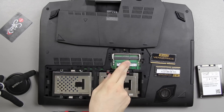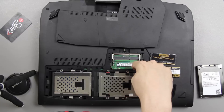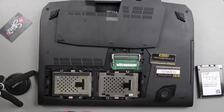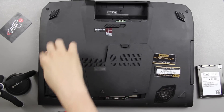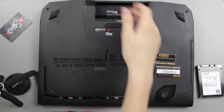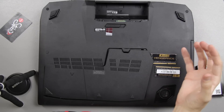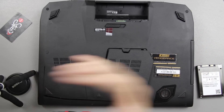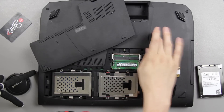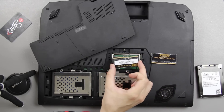This part's where you upgrade the RAM. There are actually four slots in here. As you can see, there's a Samsung stick right here and another Samsung stick below that. However, only two of those slots are accessible without full disassembly. What you have to do is take off all these screws and pull this entire back panel off. When you pull the entire back off, you'll then be able to pop those sticks out — and these are eight gigs each.